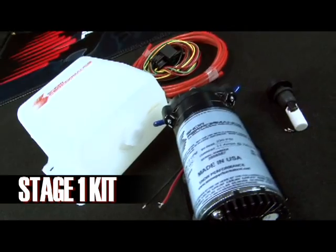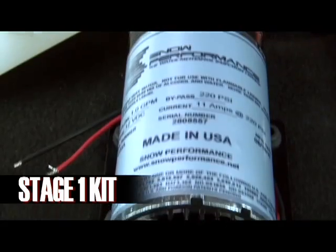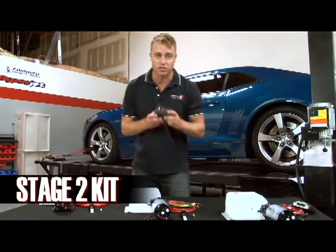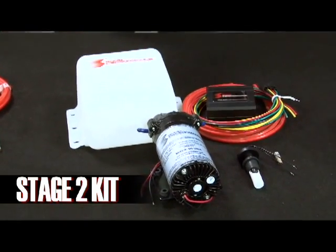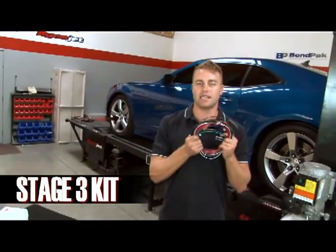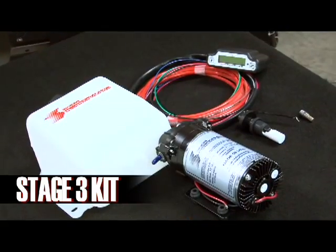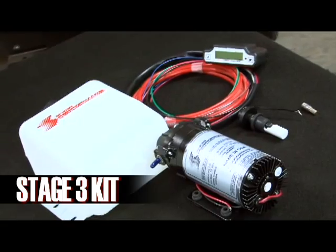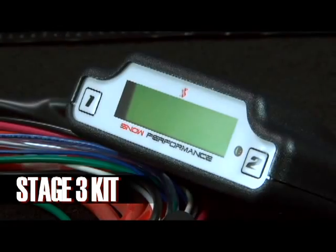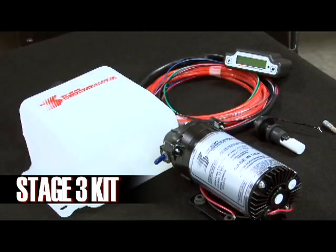The Snow Stage 1 kit is the most basic. The water methanol injection is based off vacuum — when the boost switch reaches the user-adjustable point, it injects a fixed amount of fluid through the nozzle. The Snow Stage 2 kit adds a digitally adjustable controller, which proportionally injects the mixture according to boost pressure levels, giving more accurate delivery and more cooling. The Snow Stage 3 kit goes further by adding a heads-up display that reads fuel injector duty cycle, injection percent, and boost pressure. It's the most accurate system available, extremely easy to set up and dial in, as the software creates a delivery map from just a few easy set points you can adjust from the driver's seat, allowing more area under the torque curve for increased drivability of power.